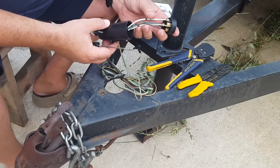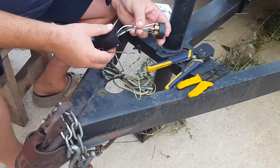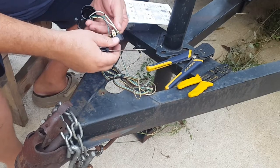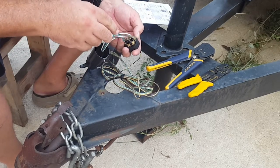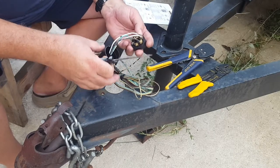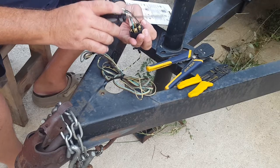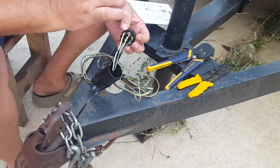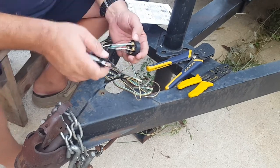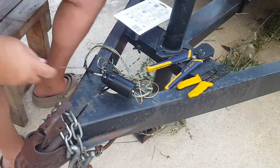I have four trailers and I've got four of these, so I'm gonna hook these up so I don't have to worry about losing my connector anymore. This one is actually marked on here too, so it's a really easy one — this is the Reese brand. You don't really have to sit here and orient it; they're all marked on here. You just get your wire, think to yourself 'okay, I'm doing the tail lights now, left tail is red,' find your red on here, connect it, and that just pinches the wires so they stay in there good.